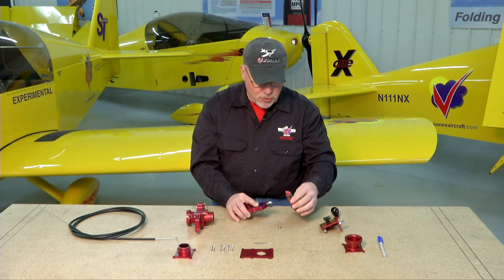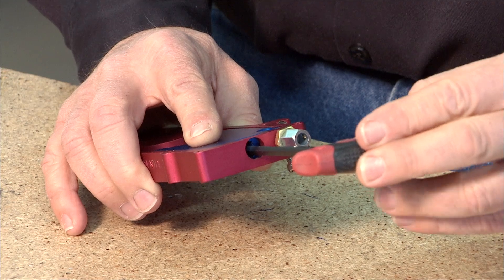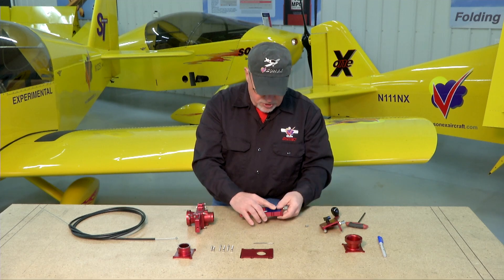When you get close, you're going to want to do this in very small increments — an eighth of a turn at a time, maybe a quarter turn if you think you need a little bit more. Small changes are better. If you do huge changes — a quarter turn, a half turn, a full turn — it's going to change the mixture so radically that you won't be able to fine-tune it. So make sure you do just an eighth turn at a time, leaner or richer. Get your proper static RPM and that proper EGT rise of about 100 degrees before the EGT starts to fall off as the mixture goes leaner and leaner.